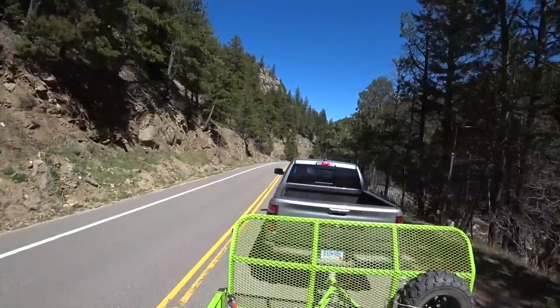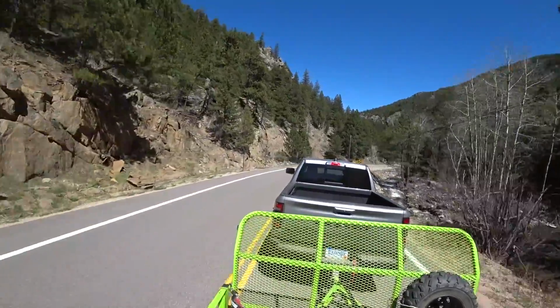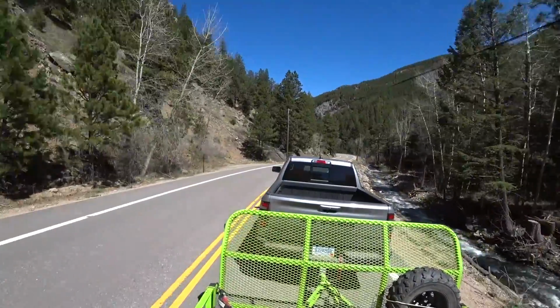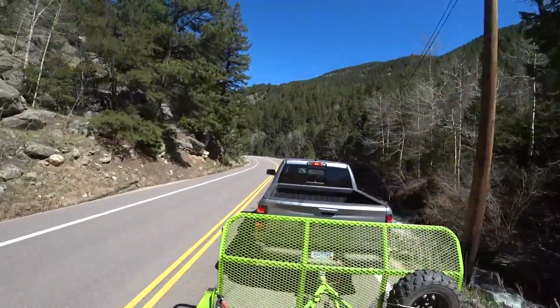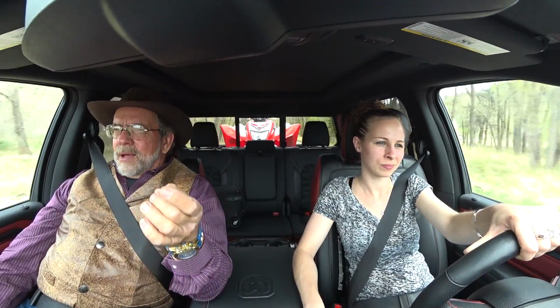But I do like the progressive springs they put on these, because when they first came out with this body style, they had straight coils and they had a smaller payload and towing capacity. Well, that makes sense. If you need bigger, you get a heavy duty. And that's what they said, and that's what I've said. And I thought that was a good idea. And then the next year, the competition just bugged them having such a low payload and towing capacity that they raised it without doing any of the coils, so it squatted more. Well, now you can get rid of the squat, because the progressive coils is how the 2500 was born with this new body style, and it makes a big difference in squat. So I like that. I think that part would work.